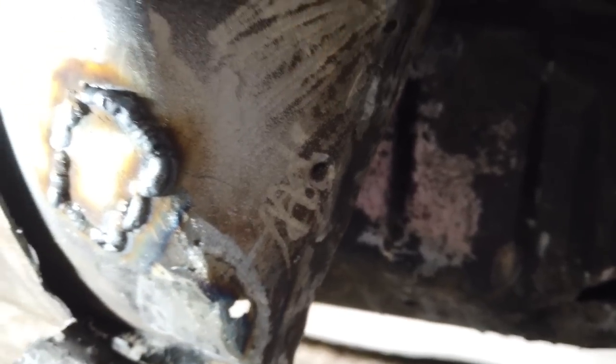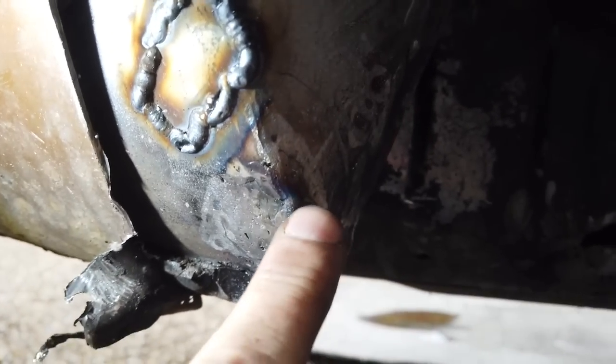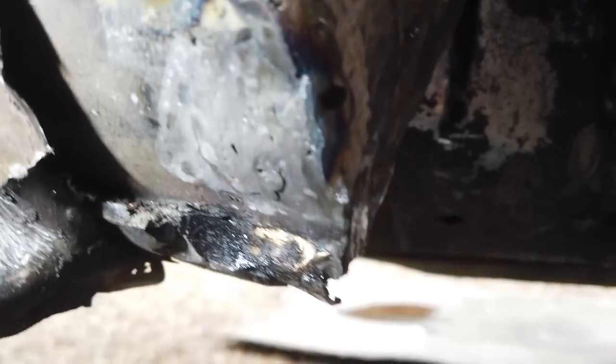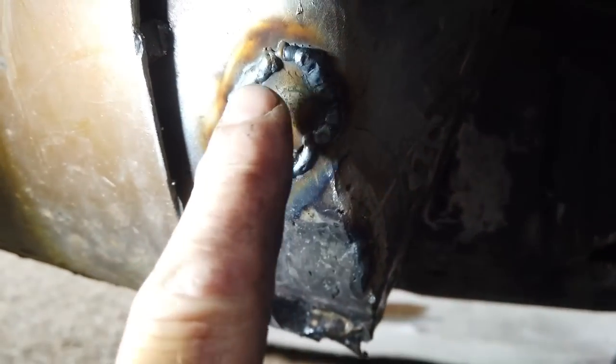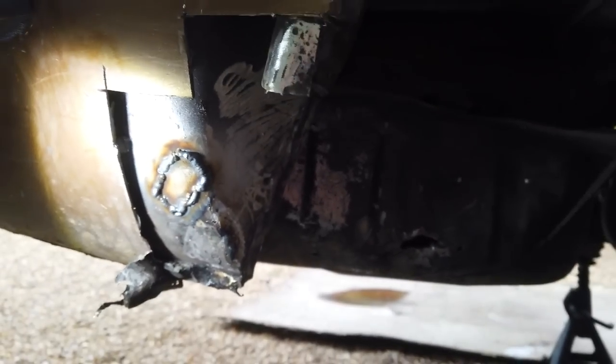Might not have to take that because I could spot weld from the back on that one, and then it'd create a nice finish for the plate. So we might plug from the back and just about get the welding torch in for that one. So we're gonna crock sander that back there. That's invisible then. Then we can offer up the plate.